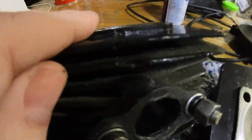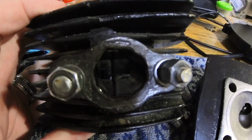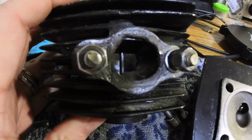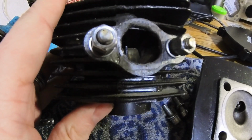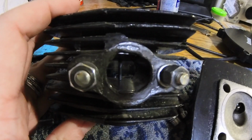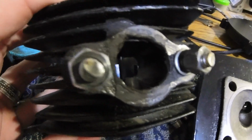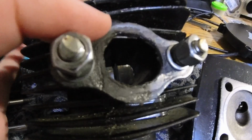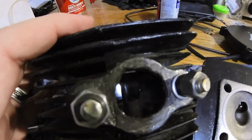Next, I went and dug in for another gasket for my exhaust. I don't know if you can see in there, but this cylinder does have a little tiny bridge back there. It's really thin and really tucked away and it doesn't go all the way down the cylinder exhaust port, which is interesting. The ones I've seen in the past go all the way down. So I'm probably just gonna leave it. It'll help the rings go across that cylinder nicely. This gasket's also been ported out, port matched basically to line up pretty well. The one I took off was complete toast.